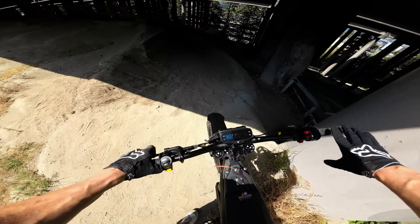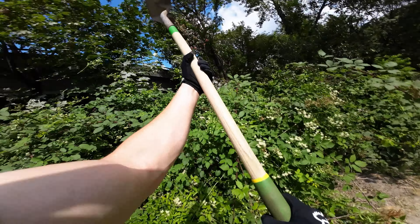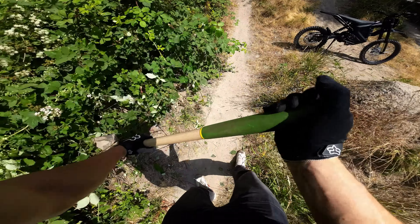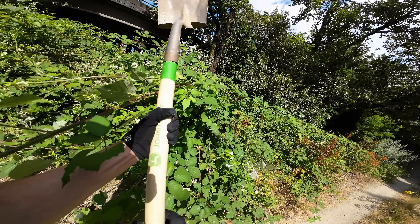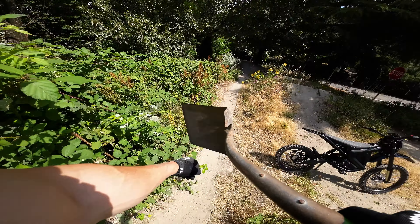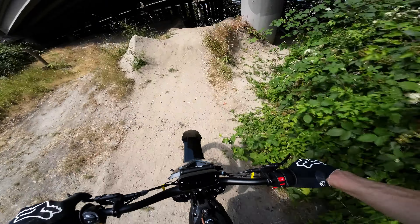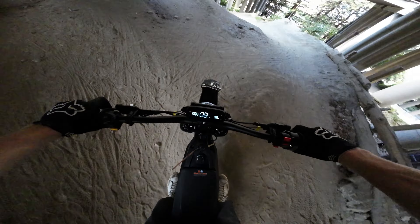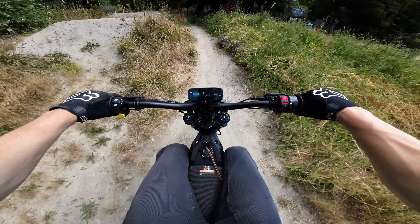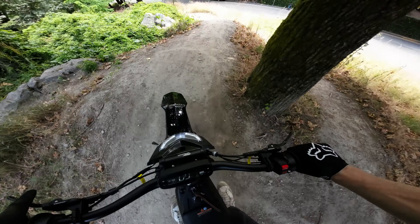With a little digging done, let's see how this puppy jumps. Much shorter wheelbase than I'm used to — I'm much further forward over the bars. This feels a lot more like bicycle geometry rather than like the E-Ride. The E-Ride has a much slacker head tube angle. On this you're much further forward over the bars — it feels very BMX-like. And you can definitely feel that the center of gravity is lower. It feels stable, it just doesn't pop up in the same way.